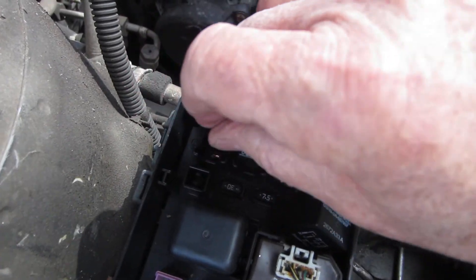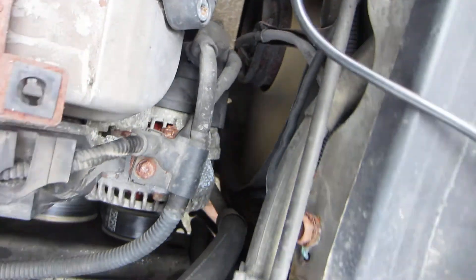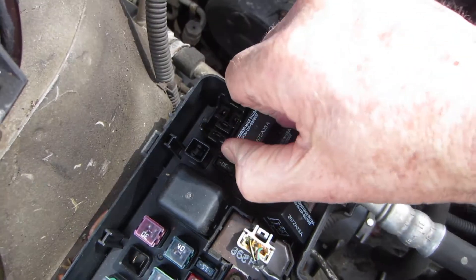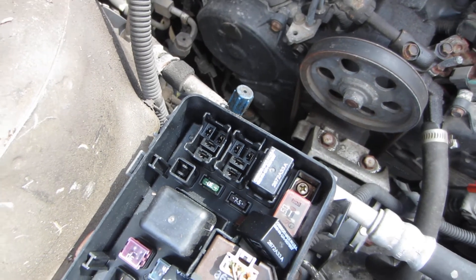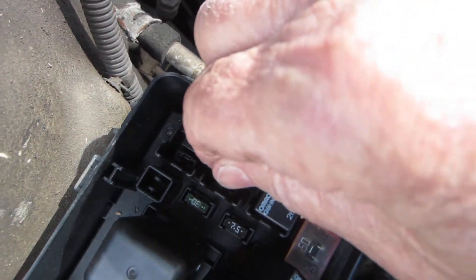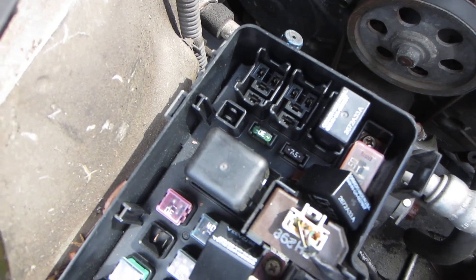Both fans run when you jump this one. There's the condenser side fan and there's the radiator cooling fan on the driver's side. Those are running at half speed because they run at half speed when your air conditioner is on before it gets up to 210 degrees. Then you pull the other relay — your cooling fan relay — jump the same two terminals in there, and that fan is going to run at full speed. You can hear it — that's the driver's side running full speed over there. So both my fans work and my cooling fan works at high speed.